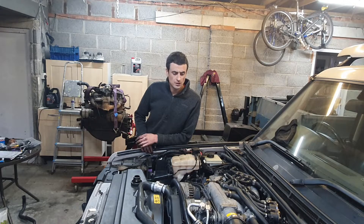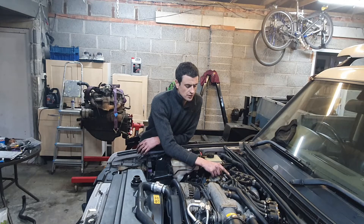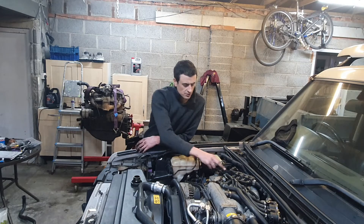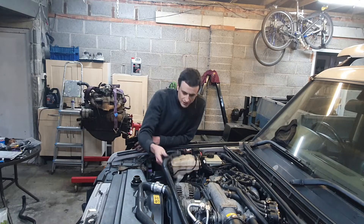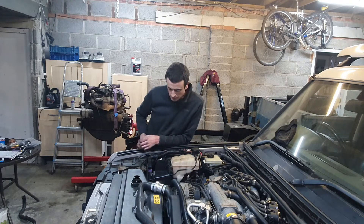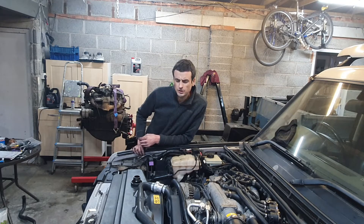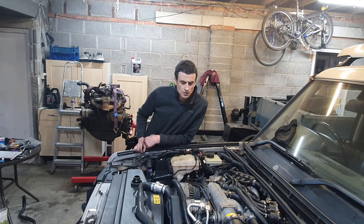I've left this hose clamp off — I'm going to pull that hose off to bleed, as that's the highest point in the coolant circuit. There's another high point here which already has a bleed. This hose goes to the LPG reducer and to the heater matrix — I'm going to bleed that one probably while it's running. I'll try them both while I'm filling it up, and try them again when running it. I'm going to fill it up with oil, leave the LPG ECU disconnected so that intercepts the signal to the petrol injectors, so it won't even try and fire up. The spark plugs are out, so I'm going to spin it for a period of time to prime it with oil — I've already done this on the engine stand. I've got this high zinc content oil to go in now for the first few hours of driving. Then I'll put the spark plugs in and the leads on, fill up the coolant, and that's it — start it up.